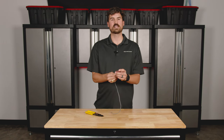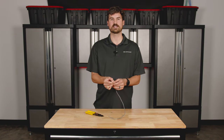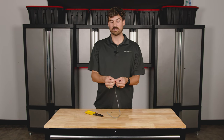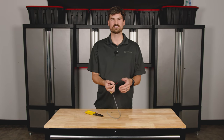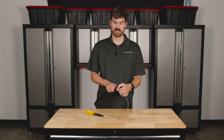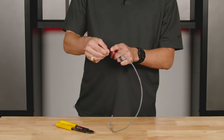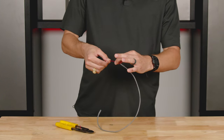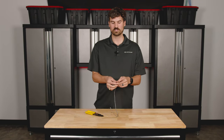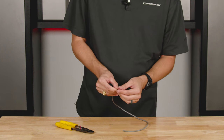The reason it's important to get a good length is because if it's too short and you don't have much copper to work with, when you try to go into that block on the back of your amplifier and clamp it down, you might get the copper wire in there along with some of the outer sheath, which isn't going to be a great connection and could cause problems. On the other hand, if you strip it back too far and you go into the amplifier with all that extra copper, there's a potential for the bare wiring to touch, creating a short. So you just want a little bit — I might have gone a little too long here, but that's pretty good and it'll give us a good connection.